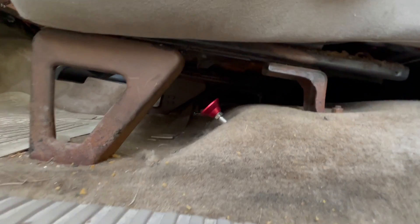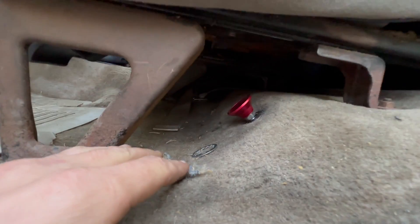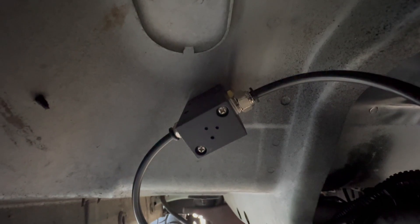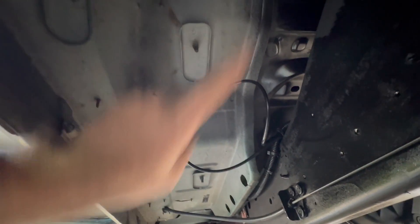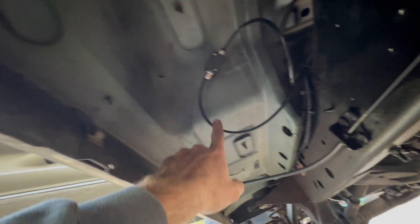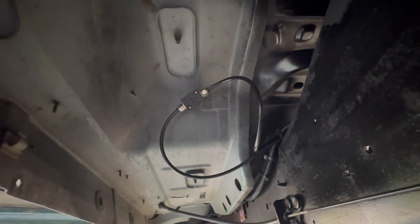If I press this in, we drop our pressure — and then as you can see, when I open it or release the pressure going to the dump valve, you can hear that pressure bleed off. That's the bleed-off we needed to get the bags to come back up, and as you can see they're back up and going. You can run a solenoid no problem, but you have to have a way to vent. Hope that was simple enough — if you've got any other questions, leave them down below. Thanks for watching, see y'all next time.